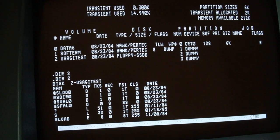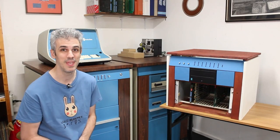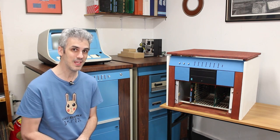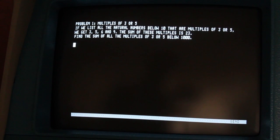We've got to get an operating system installed onto a floppy disk, but the floppy disks are really small. We've only got 96 tracks to play with and the operating system takes up like 95 tracks, so on a single floppy system that is exceedingly useless. We need to figure out a way to min-max our OS install, bring its size down as far as possible to open up spare tracks so we can put more applications on that floppy and actually make the system usable.